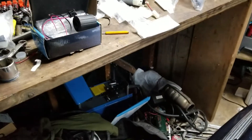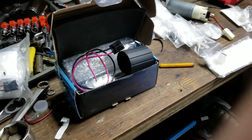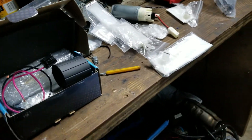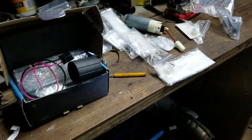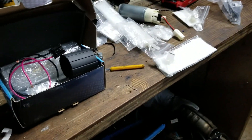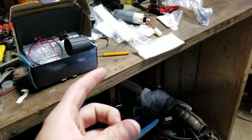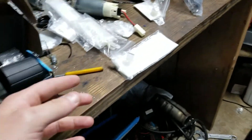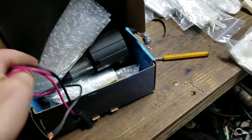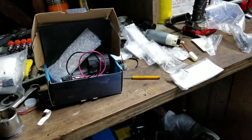I wanted to give you guys an update. I'll show you a little bit of how to take off the caps underneath the seat — it's a little bit of a pain but not too bad, pretty straightforward. Once I get my submersible fuel line, I'm going to replace the hard plastic line where it Y's off. I'll keep the Y but replace the two hard lines with soft submersible line and run directly to each pump with a check valve on there.